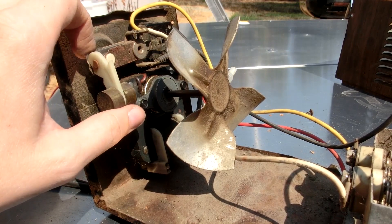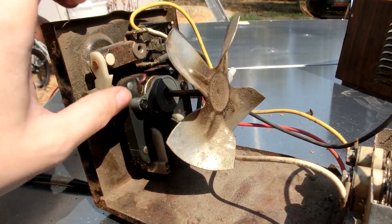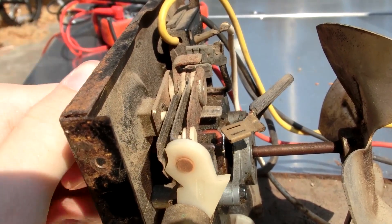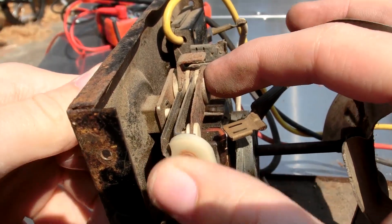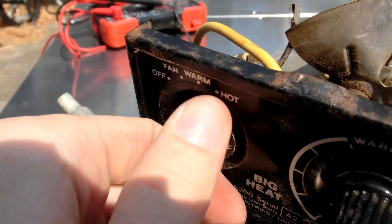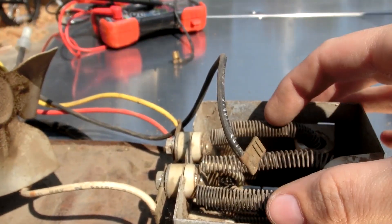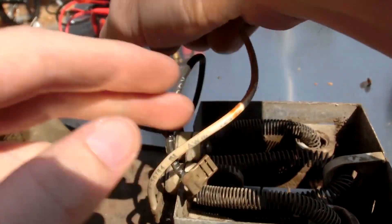Probably helps a lot of houses from getting burned down when a dog kicks it over or something like that. It's a nice little weighted thing. I guess this temperature gauge — maybe this is actually two pieces in one, like a bimetallic strip and a tip sensor. Fan, warm, hot — so that probably makes sense that it would use one coil and then both when you go from warm to hot. So we can hotwire that to be exactly what we want.